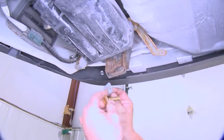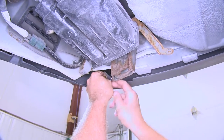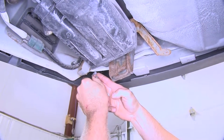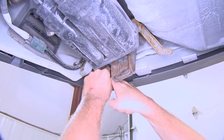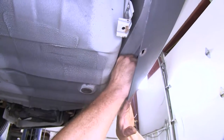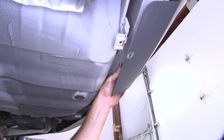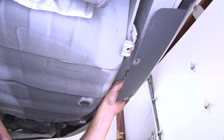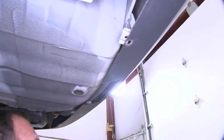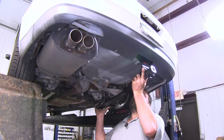We're going to take our block with our 7/16 carriage bolt and slide on the block. We'll go ahead and feed them up to the bumper, get them down into place, and make sure it's seated squarely in the block. We'll repeat the same process for the other side. You want to make sure you go through the passenger side — it's going to give you a little bit more room. Now we'll be ready to hang our hitch back up into place.